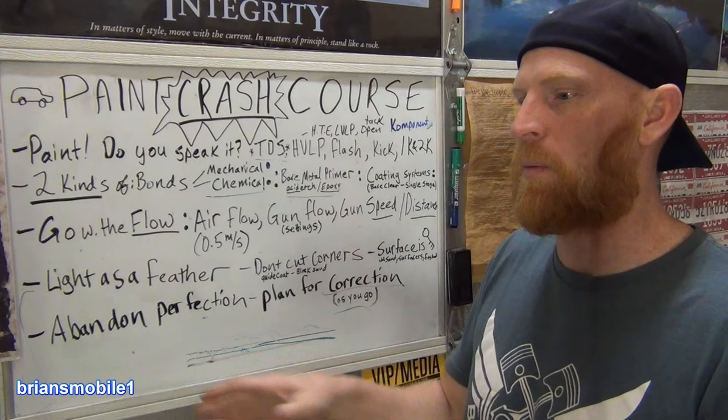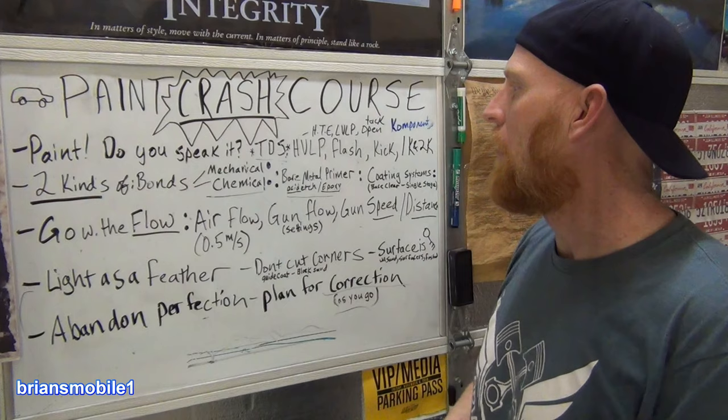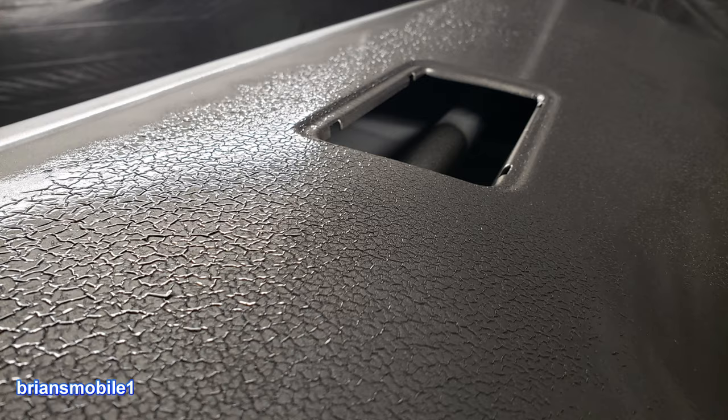And once you put clear coat on, you can't do base over it again when it's in the chemical bond stage, less than 24 hours, or else it will turn to a crinkly mess, and I learned that the hard way too. Generally speaking, solving problems wet makes more problems. Solve your problems dry with sandpaper.